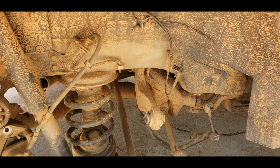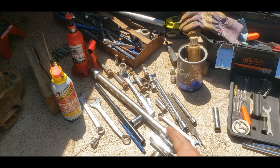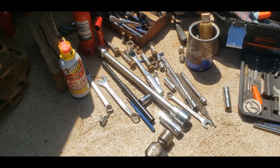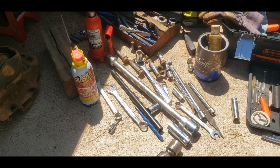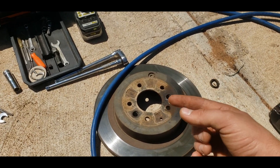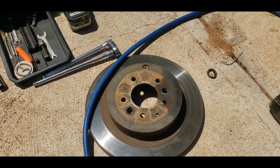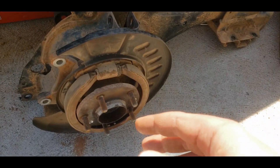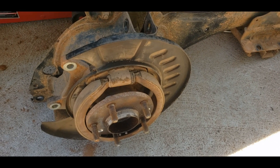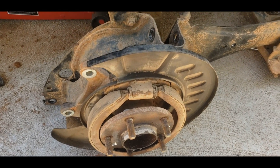That's about it for sockets — if you have a basic tool set with all the sockets, I advise having one with varying lengths of extensions and deep well and regular ones, that helps a lot. A good set of punches is also important because one of the first things you're going to have to deal with — if these are the original hubs and rotors, which they might be; this Mazda has 365,000 miles on it, these are the factory hubs and rotors. They've got the rotor screws — if you can get them out with a Phillips headed screwdriver that's great, but I couldn't, so I just drilled them out and beat the rotor off. The new hubs don't come with the holes drilled for the rotor screws and I wouldn't put rotor screws back in even if they did.